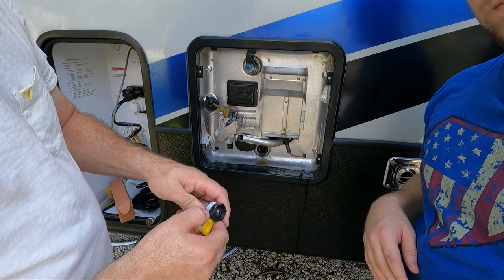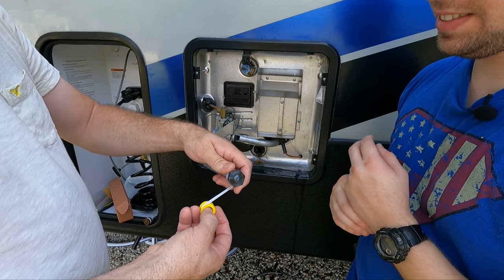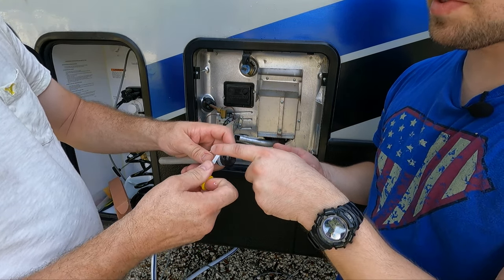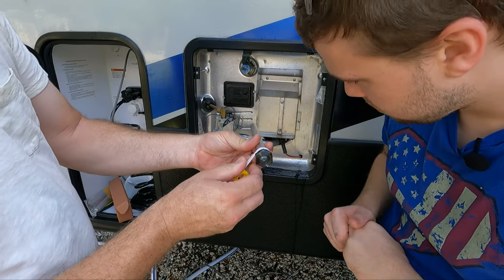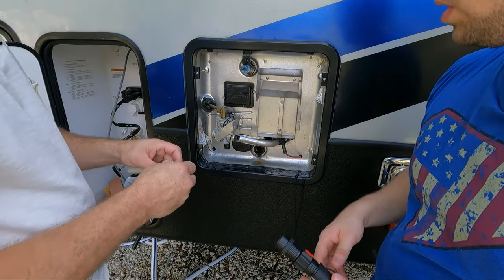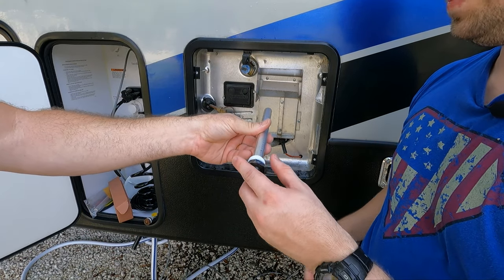Usually if it's right-hand thread, you're starting from underneath if it's in your left hand. You will mess up the thread direction at least once trying to figure out how it's going in. So it's opposite — just put it on top. There we go, that's the right direction. Basically when you're tightening this, you don't want it to undo the sealant you're putting on. Put it on this side — as you screw in it'll technically never unravel and will keep it tight. Or if you're not using tape you can use the paste kind, that's good too. Don't be afraid to get a flashlight and shine it in there and check the walls and back of the tank to see if you flushed it really well.